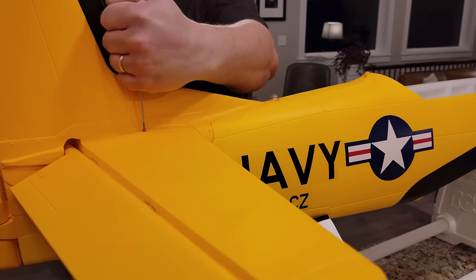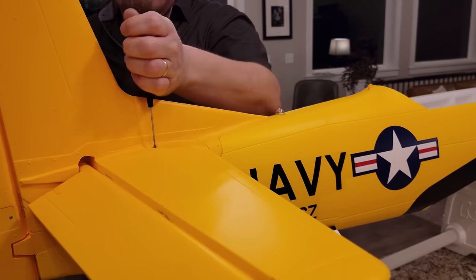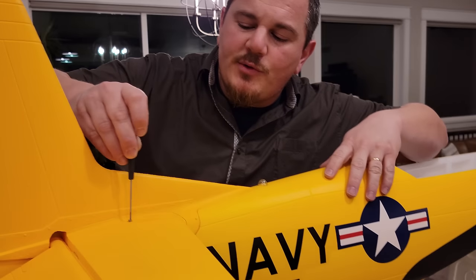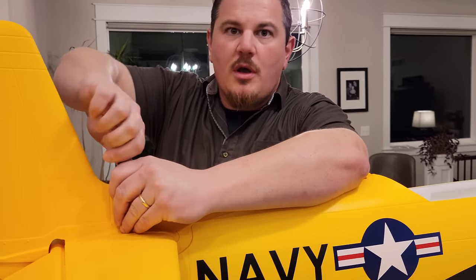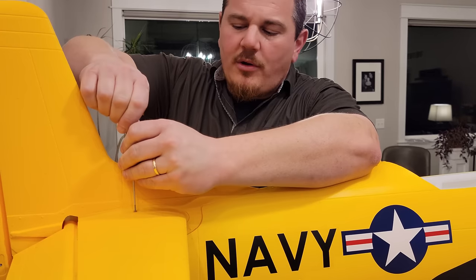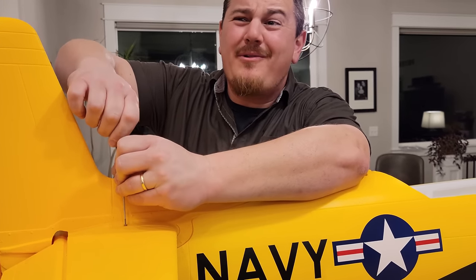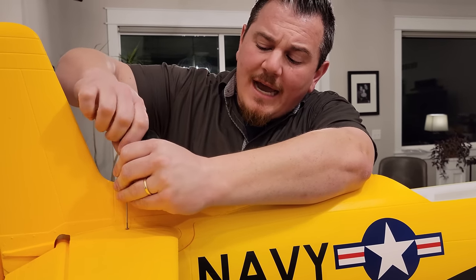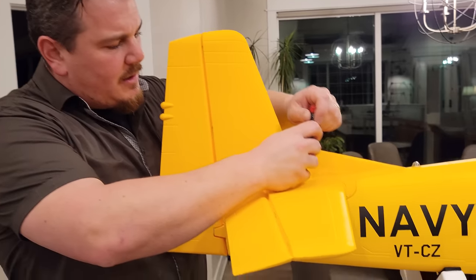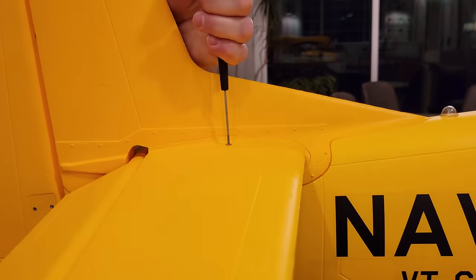There was not shorter ones, right? No. Okay. Those were the correct ones. Man, that's a lot of penetration. Yeah. So if you guys are doing this with a drill, I just want to caution you that when you do it with a drill, you will heat up the screw a lot in your nut zert, okay? So just be sparing. If you're using an impact, be careful the first few times. You may want to put a little pump of soap. Just kind of soap. Because what's going to happen is if you get it too hot, the nut zert might spin and that would ruin it. Don't do that. I hate when my nut zert spins.